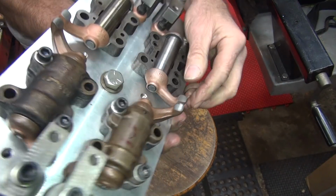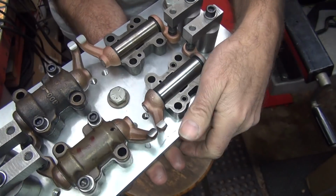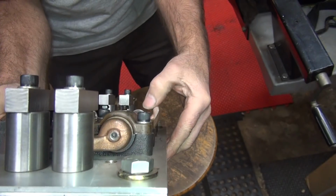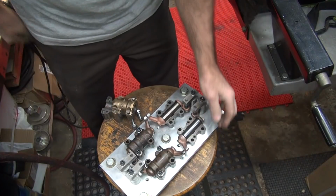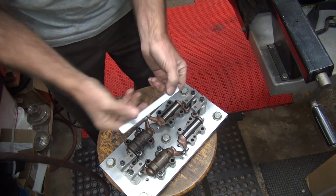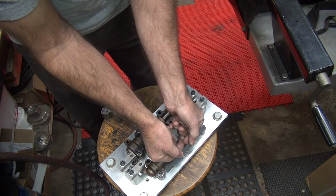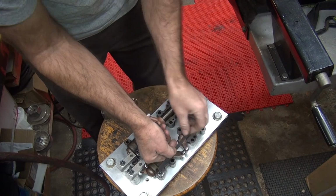Okay, and you look at the surface here, and you see if it's pretty close to what you had on this. Sometimes it's hard to tell about what you got. You look at it from a side view, you can kind of see where you're at. You can also take your 6-inch scale and just lay it across the surface, and it'll show which side's higher and lower by the angle. It changes angle like this. You can tell where high and low is at.